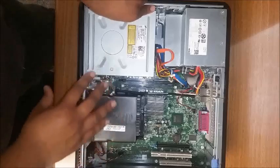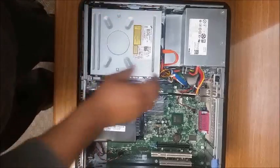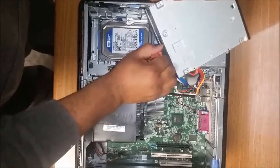I like to start off with taking off most of the peripheral items so you won't damage them upon taking out the motherboard and make it as easy as possible. First off, the CD-ROM — make sure you disconnect the power cable and the data cable.